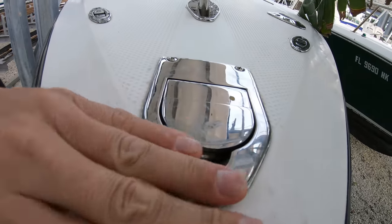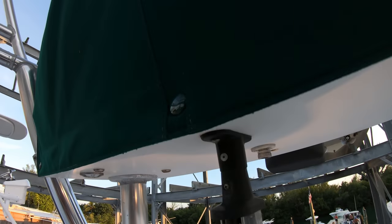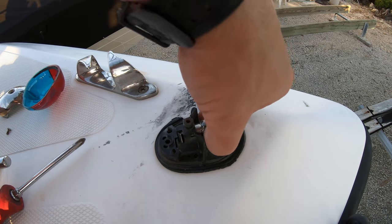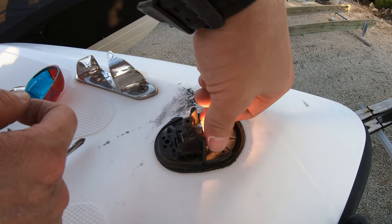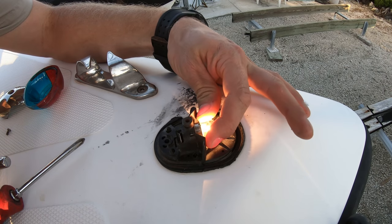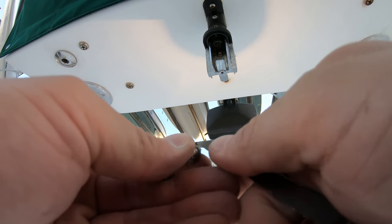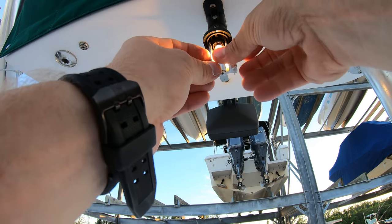75% of the time you're going to notice that you can get the lights to come on when you touch them or press them together. This is because the light bulb and the contacts are just corroded or dirty. Over time they develop a layer on the contacts and the bulb itself, and if you just take an old dull knife, a screwdriver, a pair of pliers, or whatever you have on hand that is metal and scrape the bulb and the contacts to remove that old layer, then you can press and re-bend the contacts in a little bit to create more pressure on the light bulb — and voila!